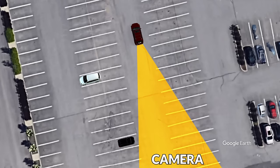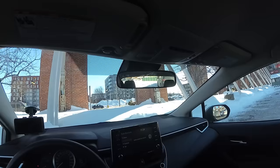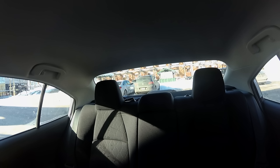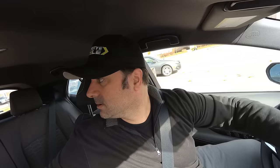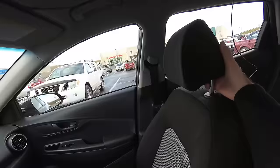You might not see other vehicles or users coming towards you from the sides, especially if they're close. That's the same limitation you have when reversing while checking your mirrors — you only see what's in the mirror, but turning your head shows you what's approaching from both sides. That's why I always recommend you look back when reversing, then check the mirrors whenever you're getting closer to something. Same thing with the reverse camera: start by reversing while looking back, then when you're closer, check the camera.